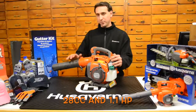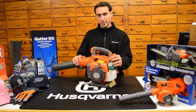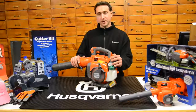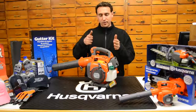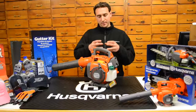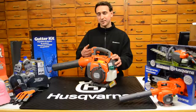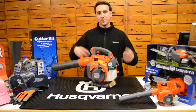As far as airflow movement on this blower, there are two different ways to measure a leaf blower: miles per hour and CFM, or cubic feet per minute. Miles per hour plays more into the role of pressure. For example, if you do asphalt or driveway sealing and you've got frost heaves or cracks, you want pressure or miles per hour to blow caked-on dirt out of the cracks so you can seal over it. In a landscaping perspective, miles per hour of pressure doesn't typically do much — if you've got a large pile of leaves and you strip the air to a small pressure point, you're not going to move that pile very well.